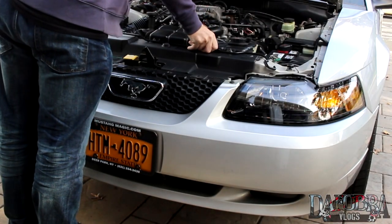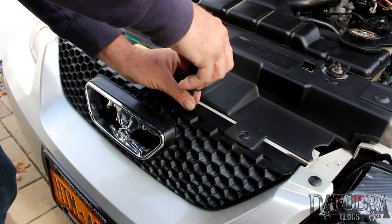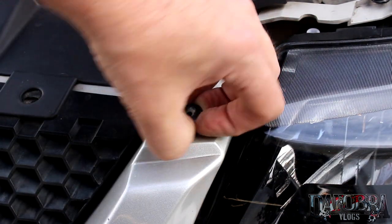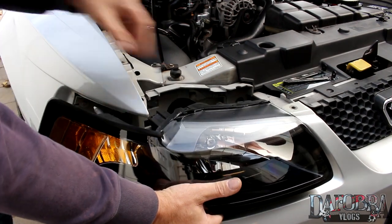The first thing you must do is pop the hood. At the upper part of the grille there are six retaining clips — these are two-part clips with a Phillips head screw going into a washer-like clip. Remove the screws and pull out the clips. To make the job easier, I will remove the headlights, which helps to access the four 7 millimeter headed bolts that retain the OEM honeycomb grille to the bumper cover.